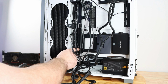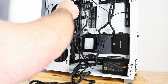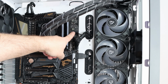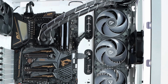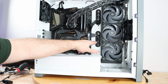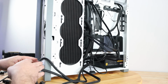I hate it because it is so large and so out of place. If and when they do replace the ATX 24 pin, I hope it's a much thinner cable that fits places much easier. So that's the reason why I put the fan cable right over here, because the ATX was going to come over here. Now if I wanted to, which I will, I can make it look like that so it's one cable. Now the video card is going to go here, so there's going to be some cables coming out of the grommet right over here. Or maybe right up the top as well, I'm not sure yet.